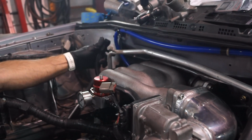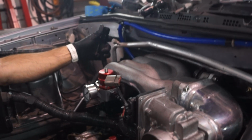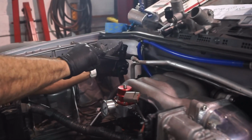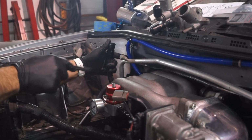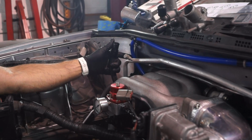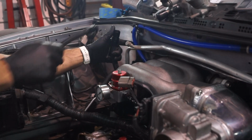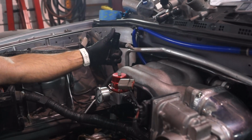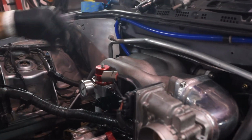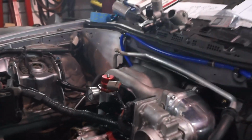That's for the oil drain. Oil catch and oil fill, because it's going to be the same bottle. So here it's going to breathe, but not fill. I'm going to put it at the top of the tank, or on the side of the tank rather, so that it just breathes and loses the oil out of the air, and it comes back into the engine as it gets thrown out. So if you start beating on this car, it doesn't start peeing all over the place. It just returns it back to the drain, which is the oil pan. So I'm working with these two hoses to make an imaginary piece that I don't have yet. You talking about the bottle? Yeah. So where do we get the material for that?